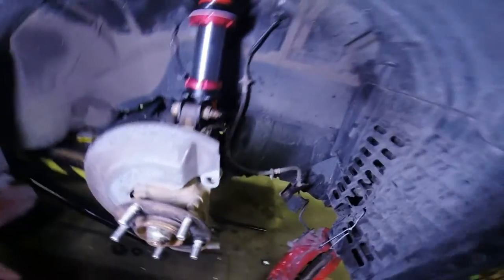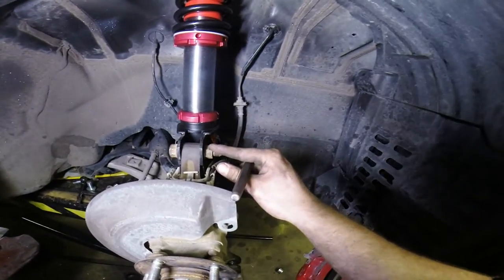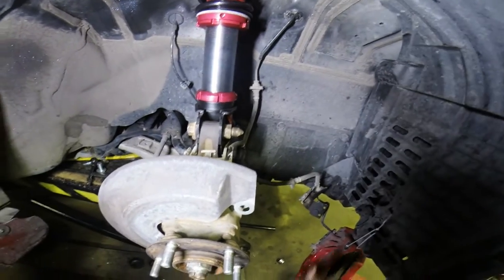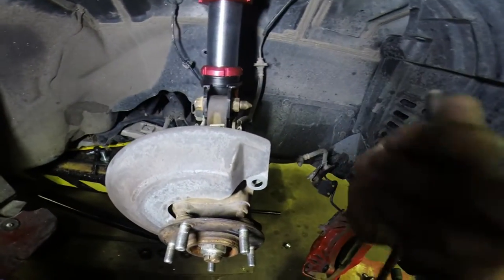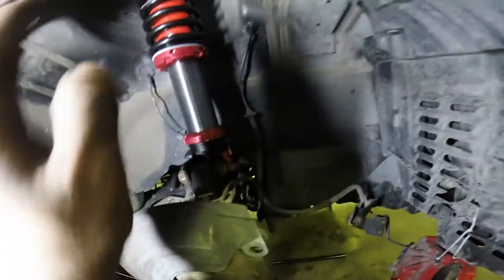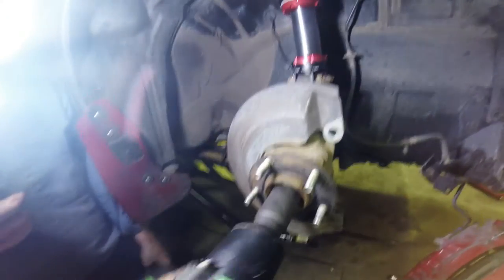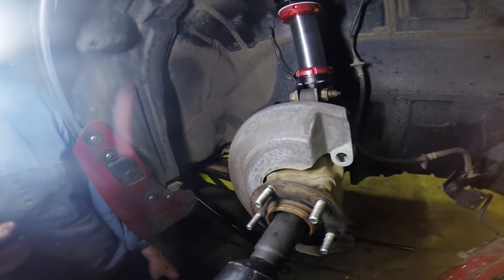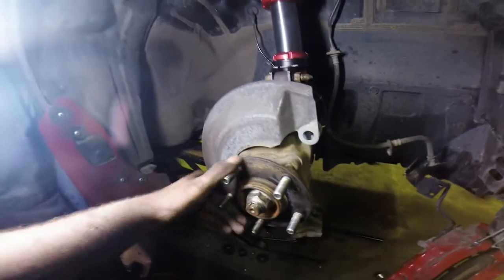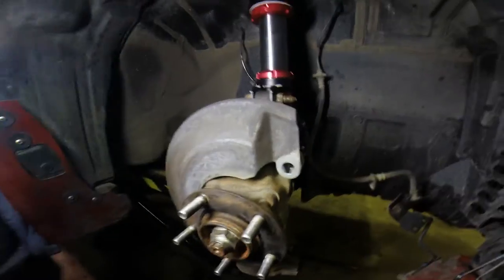Got the two bolts in, this thing is back and secured. The top slotted hole is for ease of alignment — to start off we push it all the way out, and that's going to give us the straightest setup because we don't want any negative camber inward; we want to keep it as stock as possible. I took the impact, got that started, ran it down to where it stopped and a couple turns more. There is a torque spec — I don't have it — so I just impact them down. Eventually the bearings will be replaced with ceramic bearings, but that's in the future.